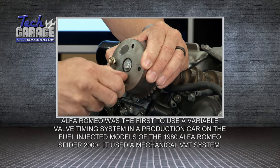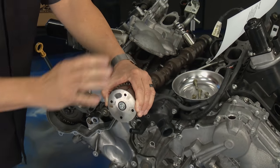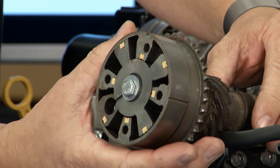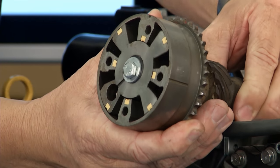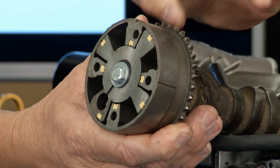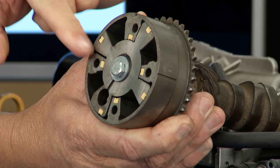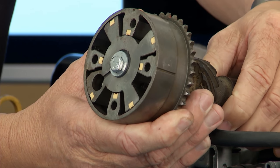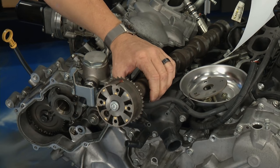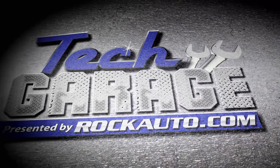To optimize performance and also EGR — exhaust gas recirculation — we can keep some exhaust gas in cylinder by affecting the timing and lower those temperatures. If I hold the timing and move this left or right, the camshaft is moving but the timing chain stays the same. If it injects oil on one side it pushes in one direction; if it injects oil on the other side, it goes the other direction. The result: optimal performance and optimal timing. But oil is key to the whole process.